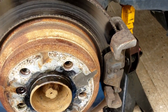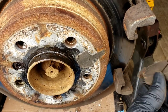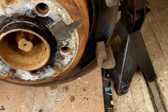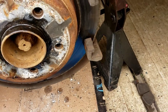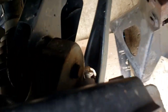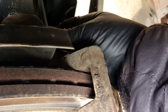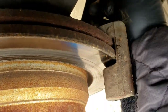Now back over here, the caliper itself — to take the brake pad off, these brake pads just sit on there. We're changing the brakes because the other side was bad. In the back here, it's a 16-millimeter. There are two bolts back here, one here and one here. Once you take them off, the bracket will come off.